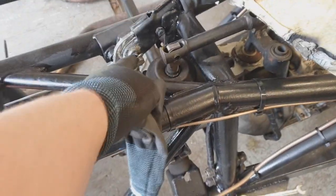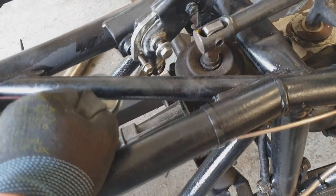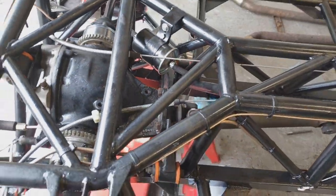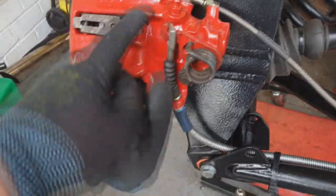The last thing: reviewing the post-strip-down list, I've noticed that the handbrake cable wasn't in a decent enough condition to reuse, so I've binned it and as you can see while we were putting the brakes on in the back, there's a new cable going on. Because I've lost all the pickup points for where that cable used to go through the chassis, and also because it's a new cable and hasn't stretched, we're going to have to adjust it. It can get adjusted on the car, but far easier with the body off. Your lever here has two bolts. The assembly goes through there with a split pin, so I've just loosely popped that in. These two lines are running to above the diff. This one here is non-adjustable — it just presses in to that little thing, comes down through a little grommet, cable tied and clipped in.